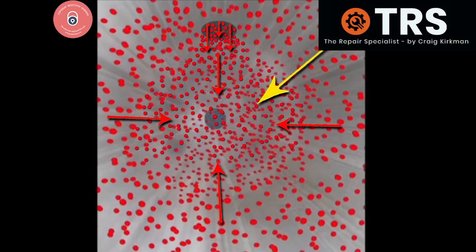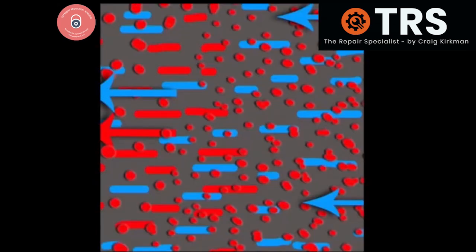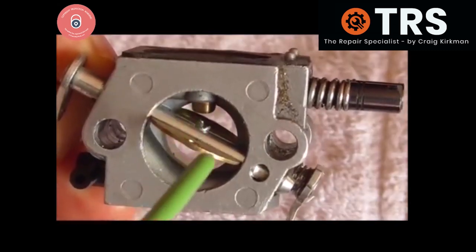So it's the fine tuning of the rich and lean fueling as to the reason why this fuel is added into the mainstream of fuel in this way. They both head down together towards the induction tube or the venturi of the carburettor. As they do, the air rushing through the venturi can be seen on its way into the engine as it passes the end of the main jet — and it's at this point that the fuel molecules can be seen joining the air flow. As it joins, it's instantly hit by the air and separated in what's known as atomized, and now it represents more of a mist than a fluid as it's pulled in through to combust in the engine.